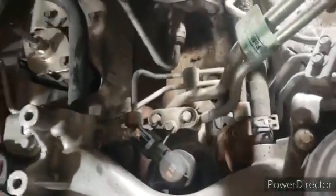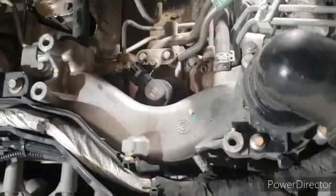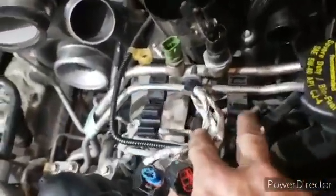Now we have access to the fuel pump and the lines we're going to modify. Go ahead and get everything brake cleaned really well, because we're opening this fuel system and we don't want any dirt or contamination getting in. We're going to remove the T20 bolts holding the fuel delivery valve in and remove this bolt and these two circlips holding the fuel supply line — this larger line here is the one we're after. We've already disconnected the sensors and released the two line retaining brackets.